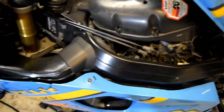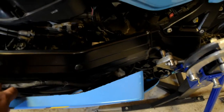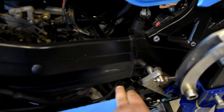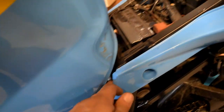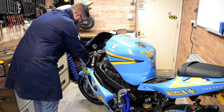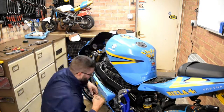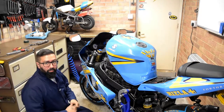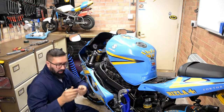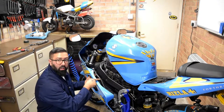Even without having to completely take apart the side panel I can just pull it away and you can easily see the original harness where it runs down here, down in there, and there is where it goes under the frame and from there runs down into the battery. A good way of keeping the cabling tucked away where it should be is to use tiny zip ties and attach it onto the existing wiring.